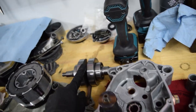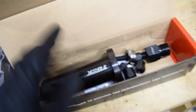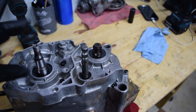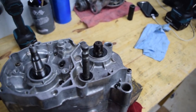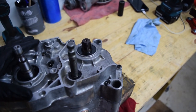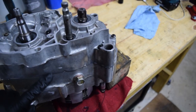And since I'm not doing this again, I went ahead and ordered the right crank install tool just to do this properly and professionally. So here's where we're at right now. I got the crank fully seated. This time I didn't damage the threads because I had the proper pulling and removing tool and install tool. Everything's in place, but not tight. The case is not tightened to spec yet. I've left all the bolts just hand tight for now so that the RTV has time to cure.